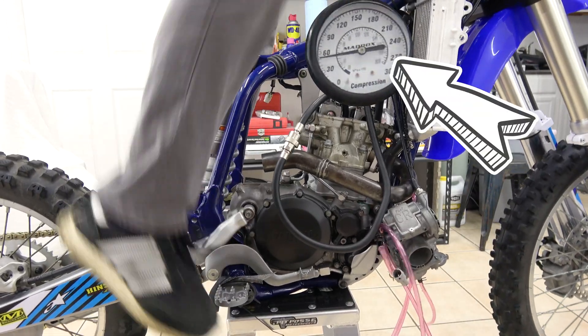An engine is basically an air pump. It needs to have good compression to work properly. If you have a leak in the system, it's going to run poorly. We all know about the compression test, which is a dynamic test where you crank your engine and read the pressure in your cylinder. If you have multiple cylinders, you can compare pressures and see if one has a problem. In my case, I have one cylinder so I can read the pressure and see if I'm in spec or if I have low compression.